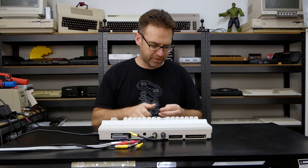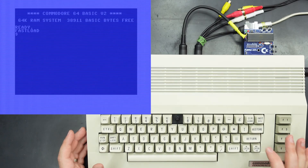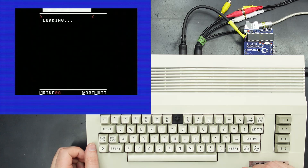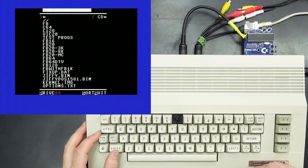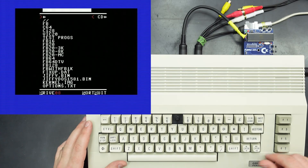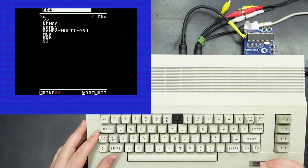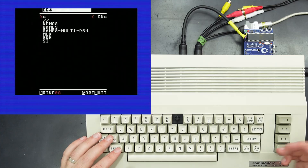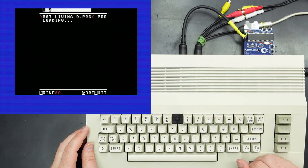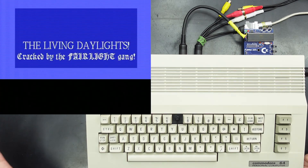Let me just grab my fully populated SD card rather than going back and copying everything over again. We'll power this on, and if we do just the dollar sign command it'll load the directory, and if I load star you'll see that we've got the Commodore file browser which is commonly called FB64. This is pretty standard with the SD to IEC — I think you might even use it on the Pi 1541 — but it's not the greatest. There is a better file commander out there, and I'll save that for the next video. For this one we're just focusing on the Epyx Fastload part, so we can navigate through here and load our 007 game, and the load speed is basically the same as if you loaded it from the basic prompt.